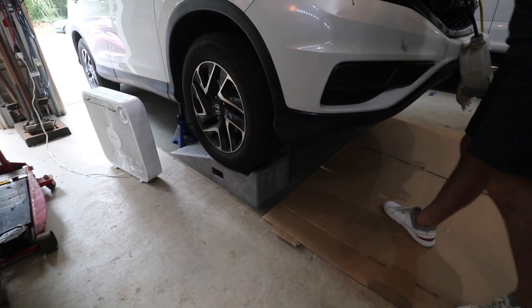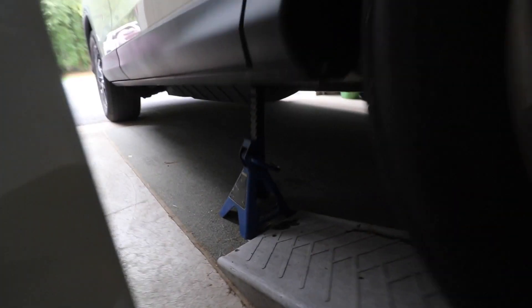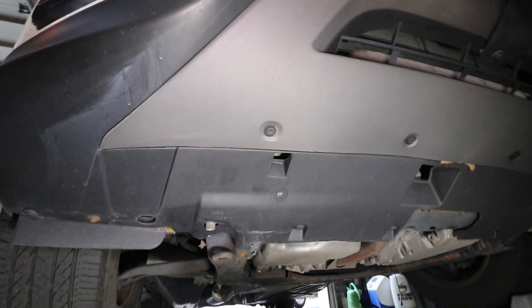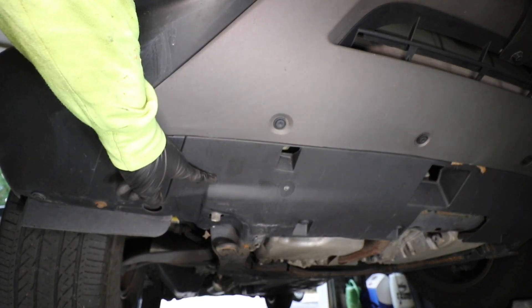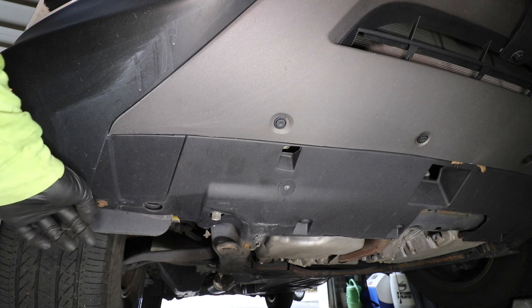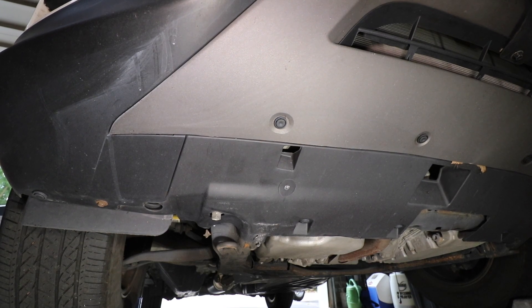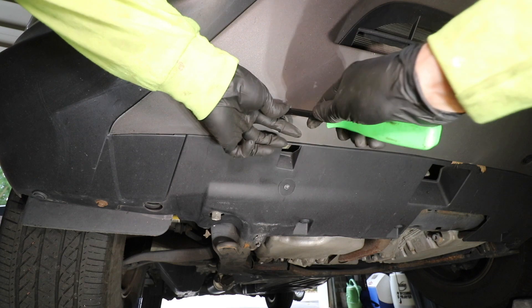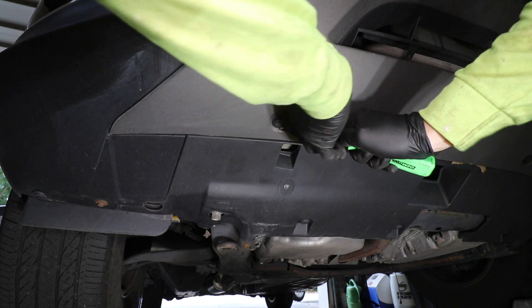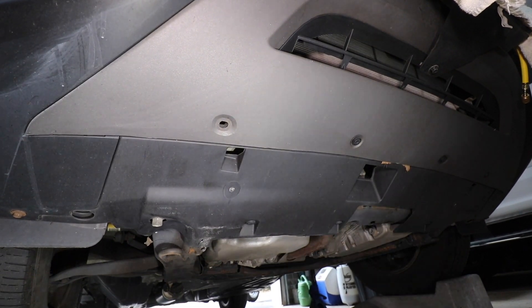Before taking the belt off, drive your car up on ramps for more clearance underneath, and make sure you have jack stands on the rail behind the ramps as a backup. Looking underneath, there are a few different panels we need to remove. There are 10mm bolts on either side of the panel, but they just spin — there's a rusted nut up top. To remove the push pins, use a body clip removal tool or screwdriver to pop them down and out.